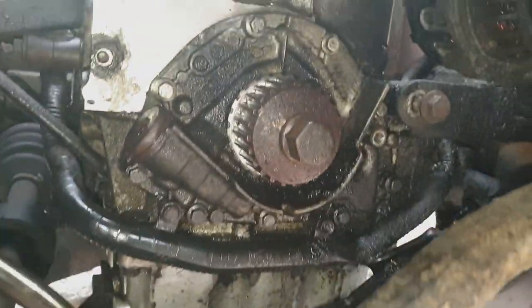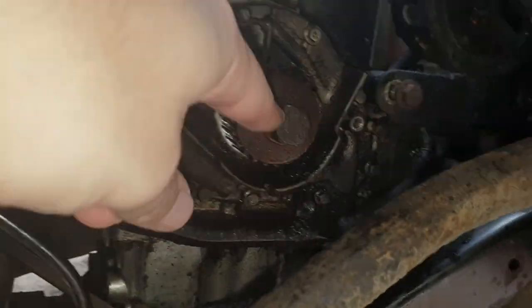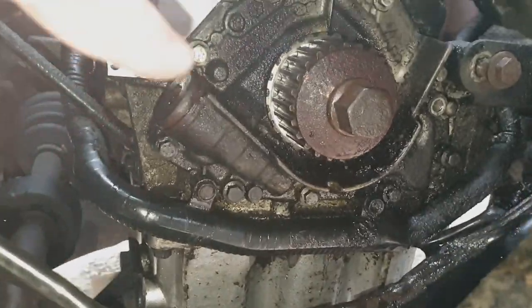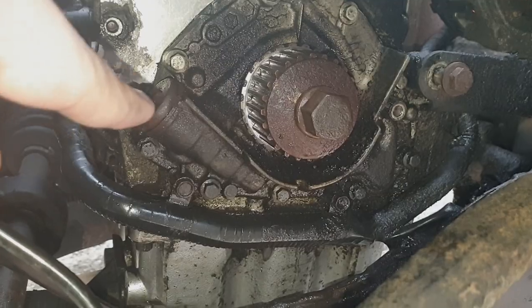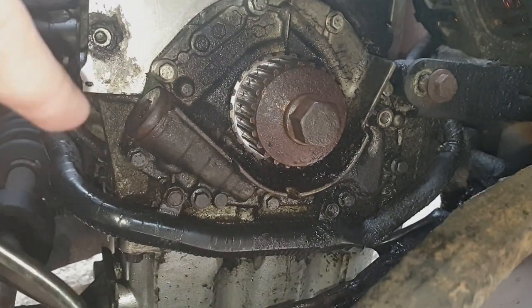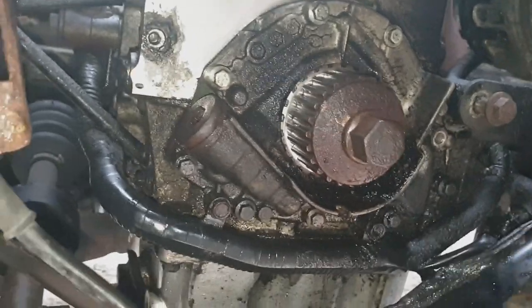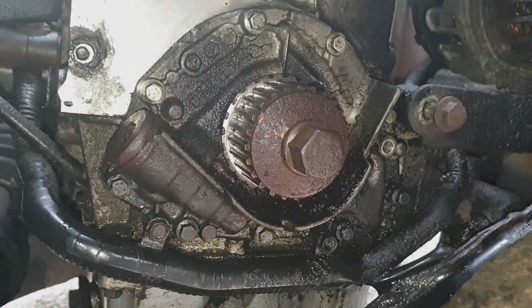Next will be the gasket around the oil pump. I'll need to take this nut off, take off the timing gear, and then undo the nine bolts plus a couple of other bolts down here to take off the entire oil pump. Behind there is a gasket and a seal inside as well. Since it's messy and the gasket kit only costs a few pounds anyway, we might as well do it while we're here. That'll be in the next video. Access is quite easy; the oil isn't drained down and I don't plan on draining it yet — I'm hoping all the oil is in the sump. Thanks very much.